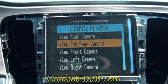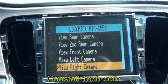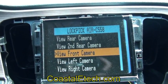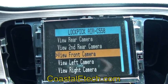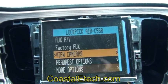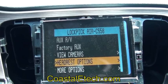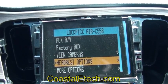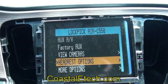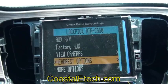There's a manual timeout option. Moving through the options, you can add a front camera. Left and right cameras will all turn on automatically — the front camera activates whenever you're driving at slow speeds to show a view at the front of the car, which helps for parking. Left and right cameras will activate automatically whenever you select the turn signals. You can also send any of these views to the headrest via another AV output from the box. Whatever you select, you can set the headrest options to show cameras, Lockpick Air, or AUX-AV — all those functions can be sent to a headrest.